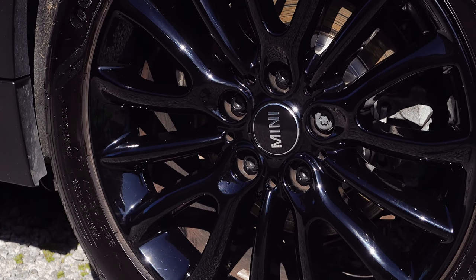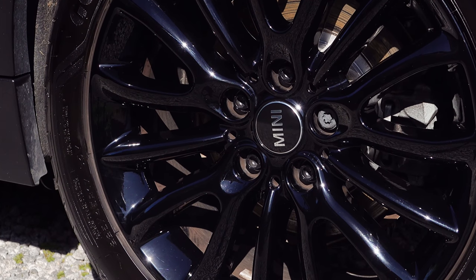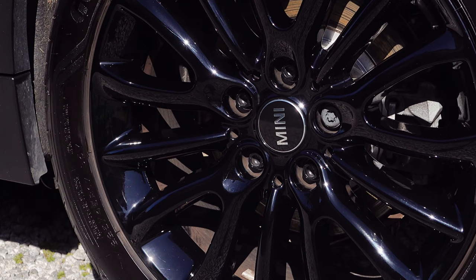Instructions for use are pretty much the same as any automotive wax. It needs to be applied to a clean dry surface, left for 15 minutes to dry, and then buffed off with a soft cloth. For maximum durability they recommend three coats — the same as any automotive wax — and I would recommend leaving at least eight hours, preferably 24 hours, between each coat. From the footage shown, I only put one coat on each of those vehicles.